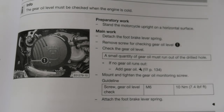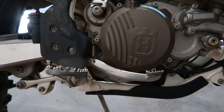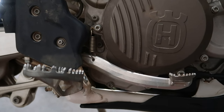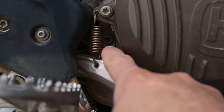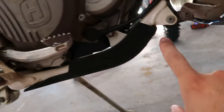What's up everybody, Ryder with Will here. I just want to get straight to the point on how to change the gear oil on the 250. First off, the back screw right here that says 'oil' below it is how you check the oil level of the gears. Oil is supposed to drip when the screw is taken out, so it's a good time to check right now to make sure you have no unknown leaks.